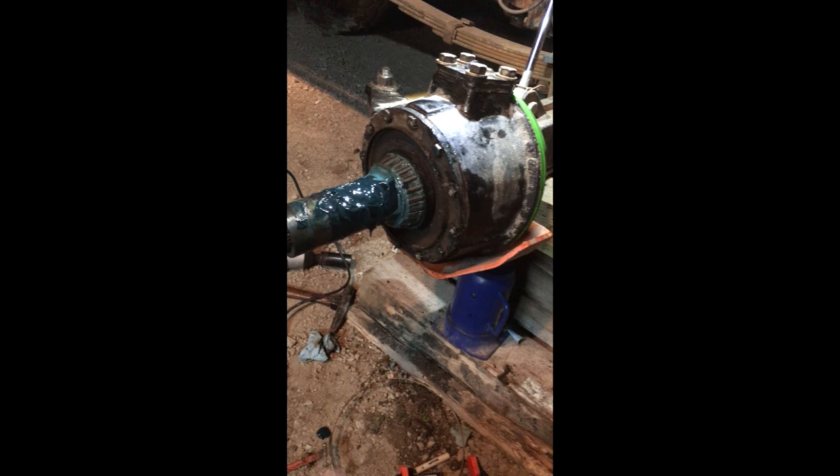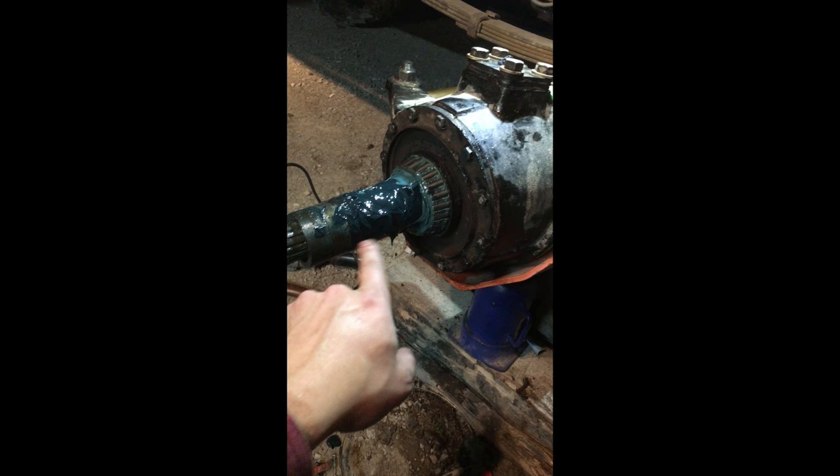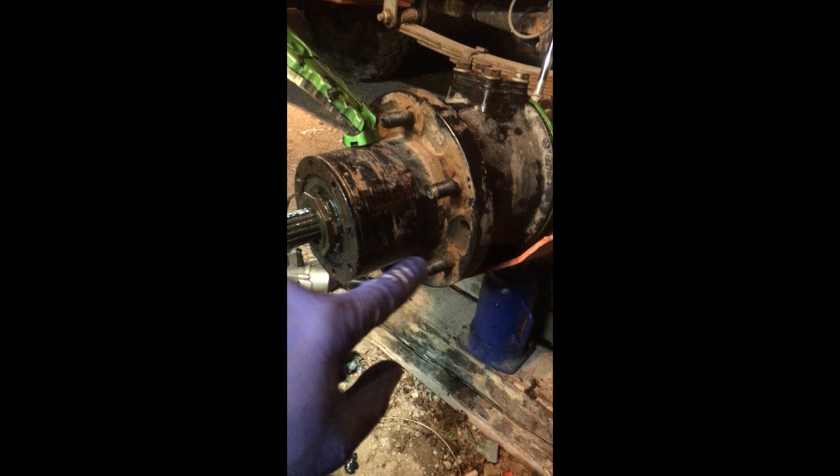Here's the drive shaft — the splines on the outside — slide the drive shaft in, then you can put your top ring out with your hub there and the bearing. Bolt all that up and then put the knuckle on over top. Torque the bearings.